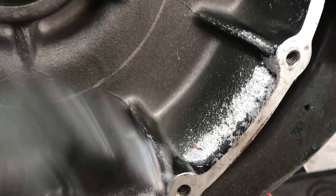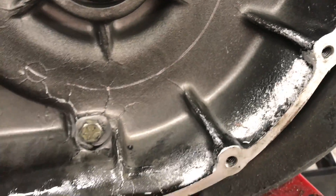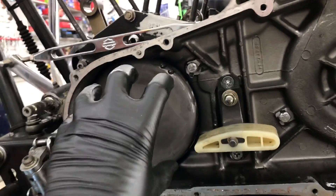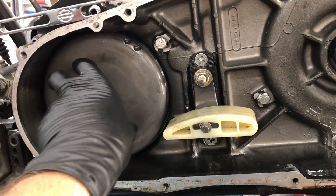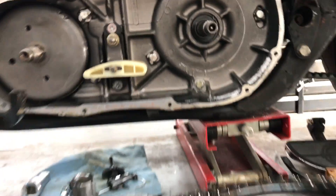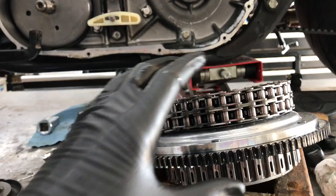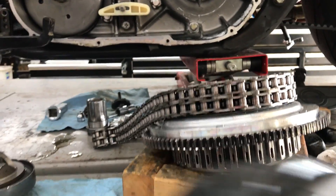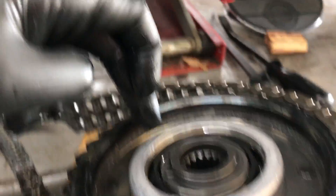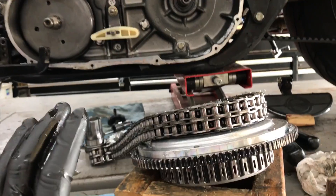If I look at the case here, you can see where that chain was whipping around, digging into all that aluminum and throwing it into everything in here. Now I'm doing an engine, so that's going to force me to address the stator and the parts under here. But this is what's often overlooked — once you take this off and you're not in there for a clutch problem, you set it to the side. This thing needs to be disassembled and fully cleaned. All that debris is in the rest of the clutch, in the chain, in the compensator — everything was compromised by this maintenance item not being addressed.